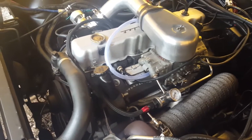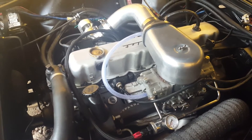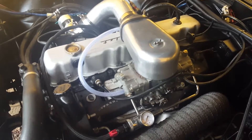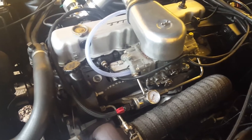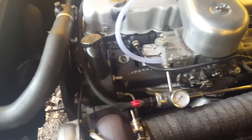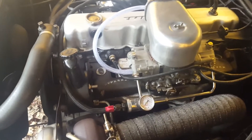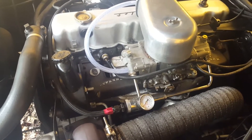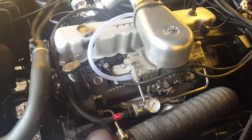At the same time, we're going to be doing exhaust seats and larger exhaust valves — the 1.84 intake and 1.6 exhaust valve — so we should get a little bit of a performance increase with that. Another issue I believe I have is a vacuum leak at the manifolds. The exhaust and intake manifold conjoin at the head, and I think there's a slight gap somewhere. I want to deal with that as well, so I'm going to take all those parts to the machine shop.